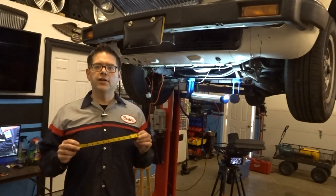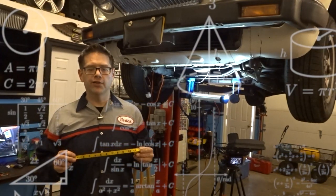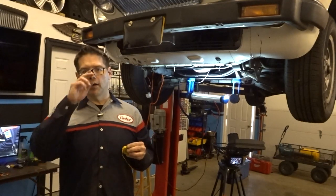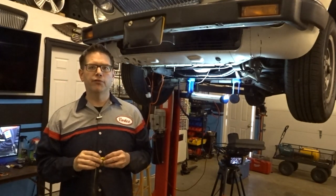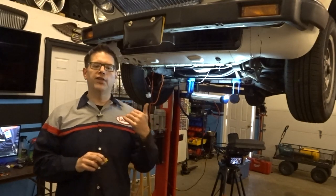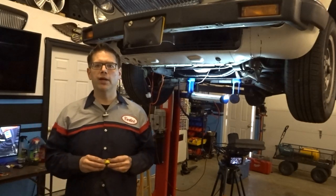If we take nine inches and divide it by 64, we get 0.14 inches. If we do 8.5 inches, that comes out to 0.133 inches. Our spec is actually 0.15 inches of deflection, which is what JAG is calling for, so our rule of thumb got us awfully close. The only issue is we don't necessarily know how much force is required for that, but we have the specification directly from our JAG service manual.